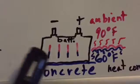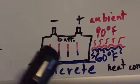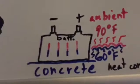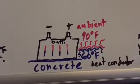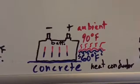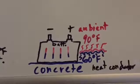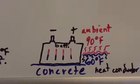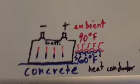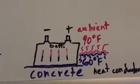When you have, that's how the battery works, is between the positive and negative, you have dissimilar metal, and then you have electrolyte flowing through the battery. So between the dissimilar metal and the medium, which will conduct electricity, that's how you get flow, and that's how you get potential or voltage, and that's how the battery works essentially. So you do not want dissimilar metal going on as a concept inside your battery besides that which is designed in the battery.